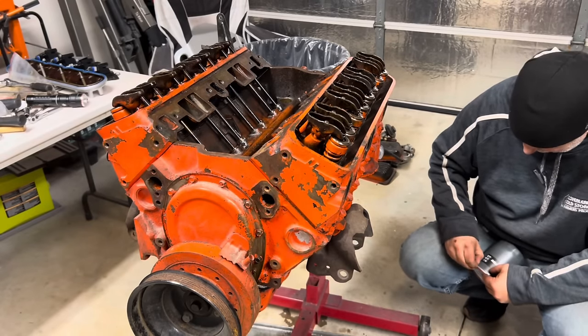And make sure we have our gasket in place here. Big old scissors for the theft proof packaging. Now, as I understand it, this thing goes closest to the engine. I don't know why. It's just what I've always heard or been told. I don't know what the torque spec is, so it's going to get the good old-fashioned German version, good and tight. We'll just go back and forth so we don't put too much pressure on one side or the other. Wrist tight is all I'm giving it. That should be fine.